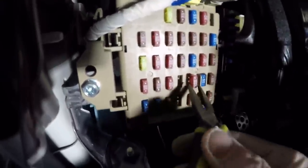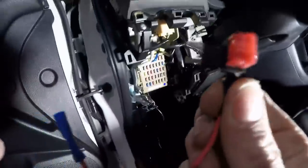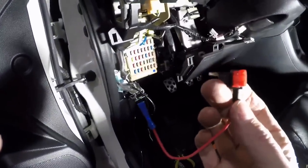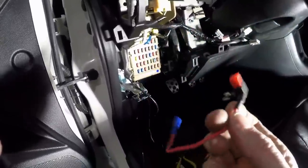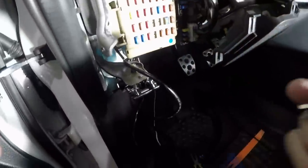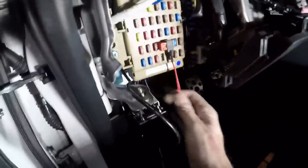Let's start with the power wiring. You're going to grab fuse number 24 — third from the right, second row up — and pull it out. Now you're going to take your ATI fuse, which has dual 10s. The dual 10s mean one 10 handles what was in the original fuse slot, and the other 10 protects whatever's attached to this wire — like a double duty. Pop it in there — beautiful, like a glove. Now I'm going to make two reds out of here to the switches and two blacks to ground.